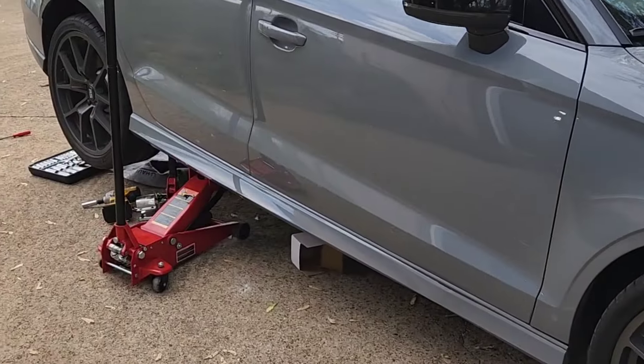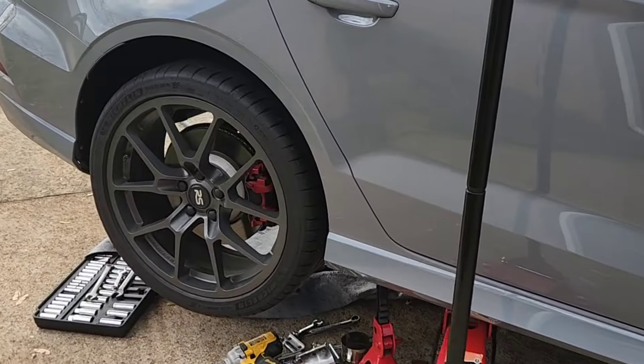That's pretty much it — just a cheap modification to a relatively expensive car to save a couple bucks. You don't want to spend a thousand dollars on a two-chamber stainless steel muffler in a housing. The Vibrant resonator is the way to go. The car sounds freaking amazing at wide open throttle. I did have to adjust the exhaust because it's a slip fit and it was leaking — I could hear it at the joint where the mid pipes connect to the exhaust near the mid portion of the car. Hope you enjoyed the video!